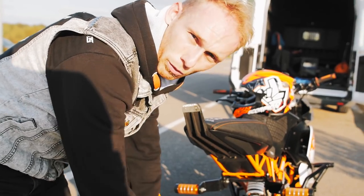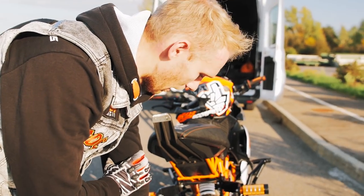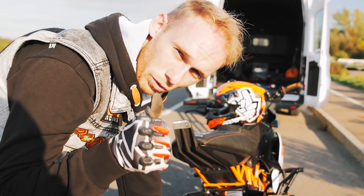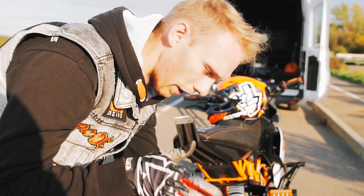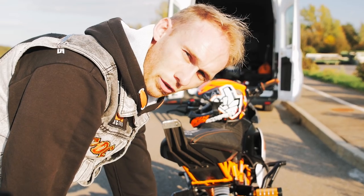That's a small hint. If you want to drift and your tire has too much grip, put a bit more pressure in it, and then it's easier to drift. On a small bike and also on the big bike, it doesn't matter. So let's go for a drift session again. Drift session with a 3.0 bar.